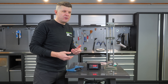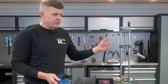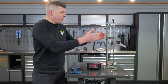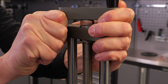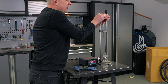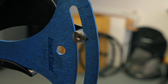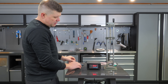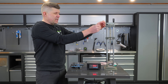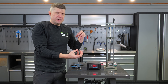We've got to take the average of all the spokes around, and the deflection reading is not a precise measurement — we're not down to small decimals here, keeping it fairly round numbers. When the tyre was off we had a tension of 15. That doesn't take an awful lot to get up to. It's so small — we can see why in wheel building we don't go into really small numbers because the movement is so small. That's 15 on our gauge. With a 15 deflection, we have 99.2 kilograms of force — a very, very small difference. Carbon spokes really don't stretch very much at all.